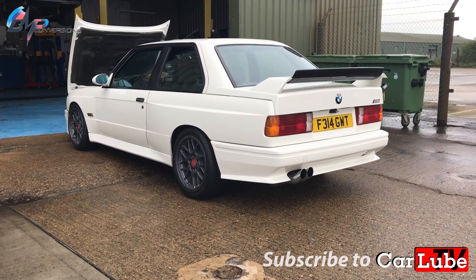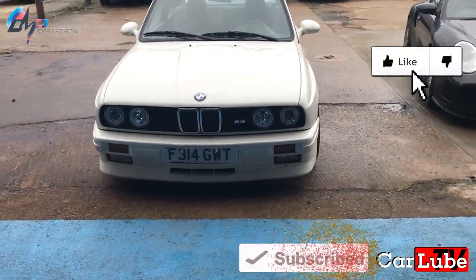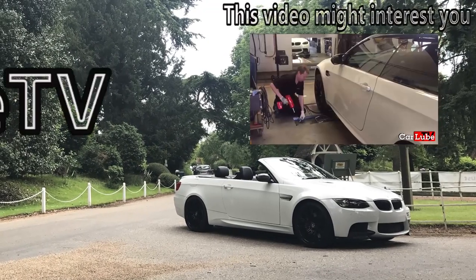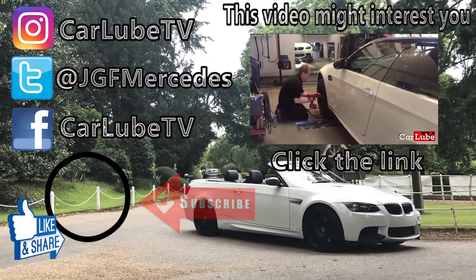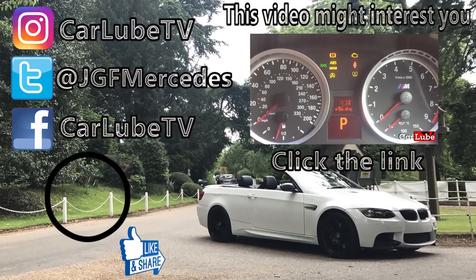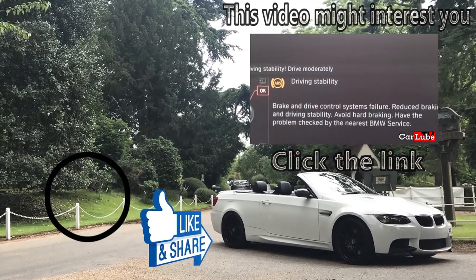I hope you enjoyed this episode — please give it a thumbs up and subscribe so you don't miss out on the next episode. We are going to change one of the front ABS speed sensors on my M3. In my experience having changed all four sensors, they are very fragile. If you get a warning light on the dashboard, most of the time it will be the ABS speed sensor at fault. It's a good idea to plug in a fault reader to tell you which one is faulty, as there are four.